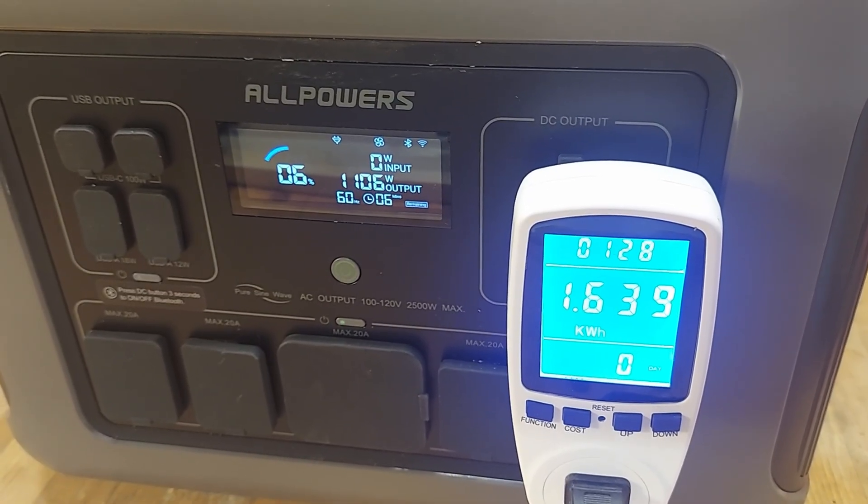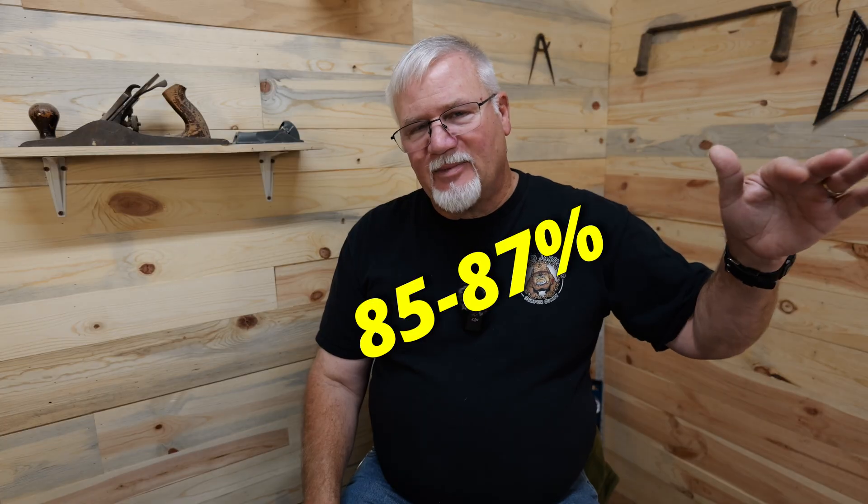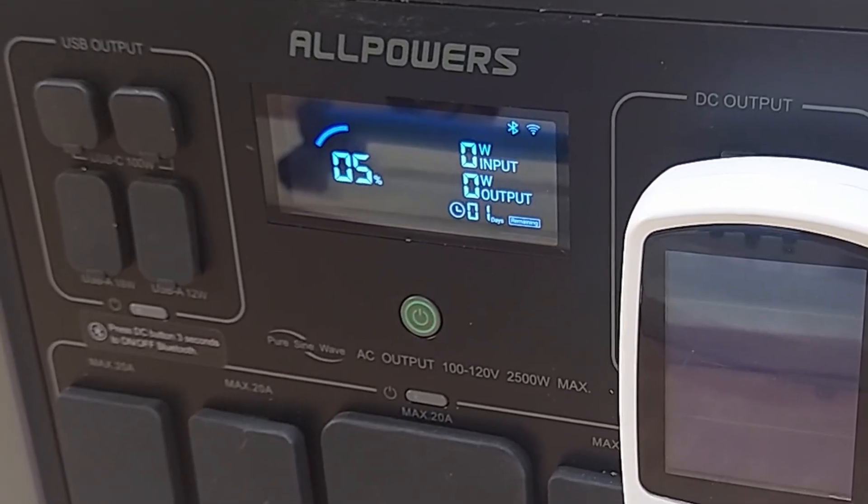Under testing, I found it was right between 80 and 85% efficient — meaning I was able to draw about 80 to 85% of the total battery capacity. It did stop at 5%, which protects the unit. Even under heavy testing drawing over 1,100 watts continuously, it never really got hot and the fans didn't ramp up much. When I went to charge it back up, it was only charging at 1,000 watts and wasn't noisy. Once I found the fast charging option in the app, it definitely charged up a lot faster, and you can add solar at the same time to charge even more quickly.